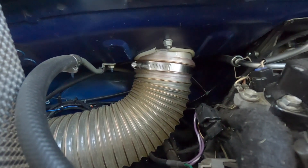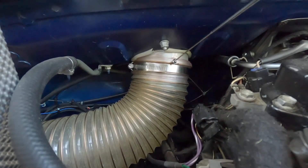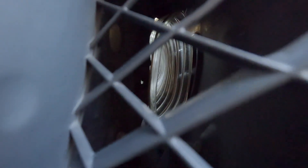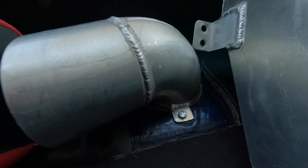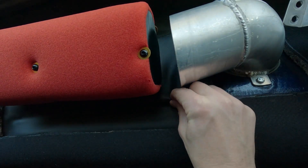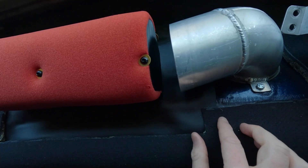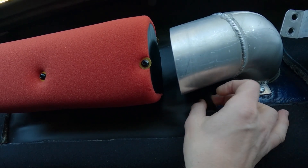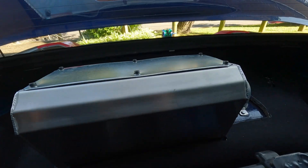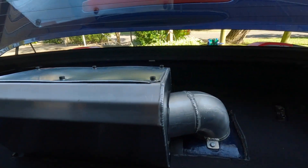Here is the engine bay side of the cold air feed which hooks up quite nicely. It's fed by a cold air feed from the side — I had a fabricator do up all this alloy piping and box. I could do a bit more in the way of heat shielding; it is fed from the left hand side duct. It could be cleaned up a bit to allow more airflow, but it seems to do the job. Currently driving at about a couple of degrees above ambient temp, and it is sectioned off from the engine bay with a high temperature silicone sheet which does a wonderful job keeping the engine heat away.